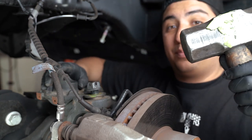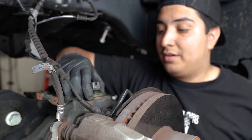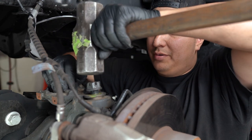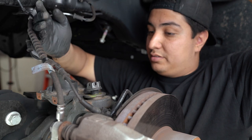For that we're going to use as big of a hammer as you can find, because sometimes these things are really in there. If they don't want to come out and they're being too stubborn, I would recommend using some type of penetrating lube. It usually does come out pretty easily especially on newer trucks, but what you're going to want to do is hit directly on the top of this stud. Let's get to it.